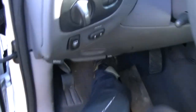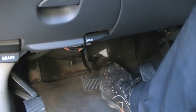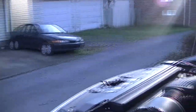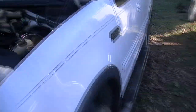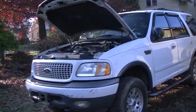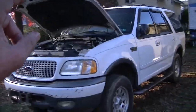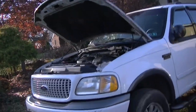Take the board out — we're done. Pump that pedal — brakes are really hard. Let's start it up and see what we've got. Finally, folks — I've got a nice full pedal. It took a while to get the air out of the system, but once I got the air out, big improvement. That's how you change your master cylinder on one of these SUVs. If you have a car, it's probably the same process, but it gets a little tedious getting the air out. If you have a buddy to help you bleed those brakes on the wheels, it really makes a difference. If you have brake problems, look underneath first — make sure you don't have a leak, because you don't want to replace expensive stuff on top only to find out you had a leak on the bottom and your brake booster or caliper was just fine. Thanks for watching and good luck.